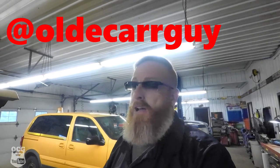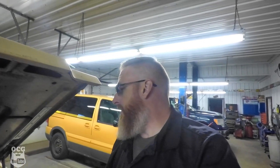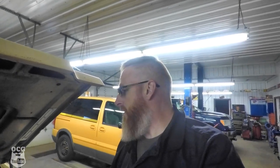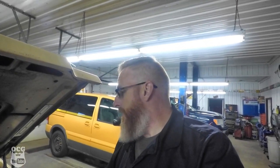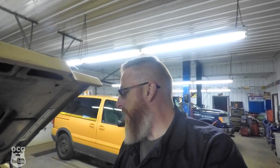It's mighty frustrating. I thought that I had an isolated problem, and as you know, if you guys follow me on Instagram, at Old Carr Guy, you'll know that I made a post just last week about getting almost 4,000 miles on this truck since we built it, and since we had really any major issues. And so how is it that we go that long with no issues and then all of a sudden another rocker arm? Again, I'm of the belief that it's an isolated incident because we are using old original parts. So from here on out, new rockers, new rocker retainer nuts and washers, and new push rods for sure.